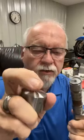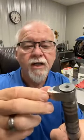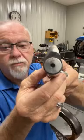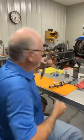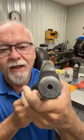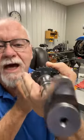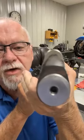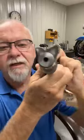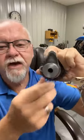And then in about 8 runs, the buckets would be worn right here so bad, and it must have been catching on fire inside the engine, and we didn't know it. So he would turn this down. Finally, I got down to a 975 base circle. 22 years ago, y'all. And it didn't take but a minute for me to really get dumb and do a 720 lift. Think about a Z1 or a KZ or a GS 1100 or 1150, 2-valve, 720 lifts.